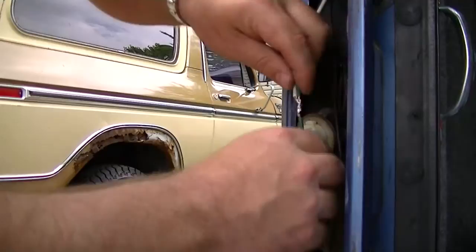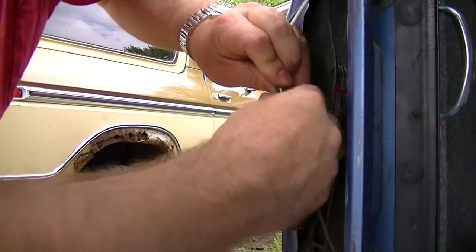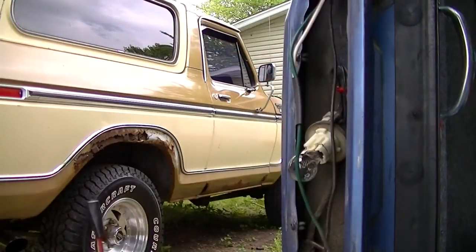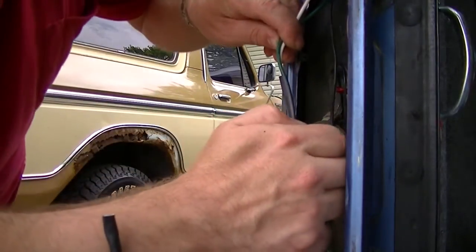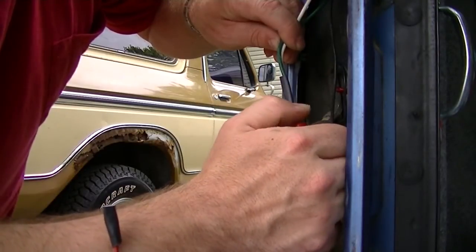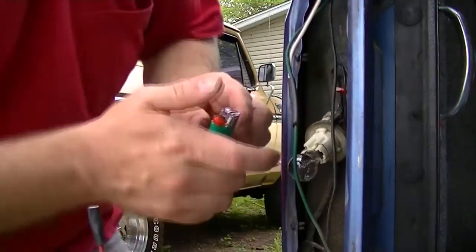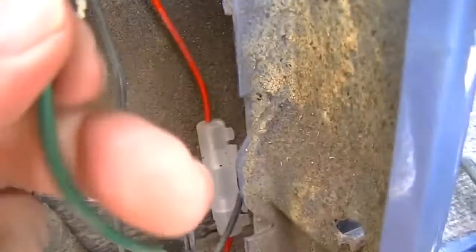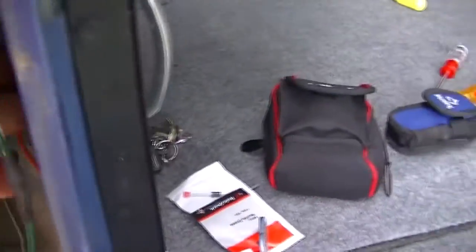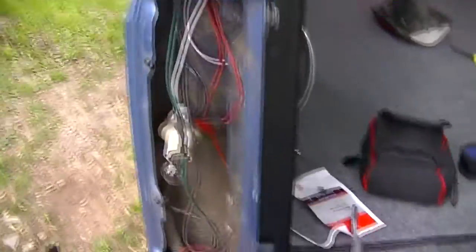Now I will just slide the heat shrink right over this splice, just like that, and put the heat to it. Well, wind's going to blow it out today, evidently. Okay, I had to do that off camera because you wouldn't have been able to see it anyway, because I had to shield from the wind where the camera was. So that's all nice and spliced together. I'm going to go ahead and plug this fuse back in, and let's see how our adaptation worked, you might say.